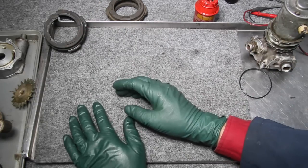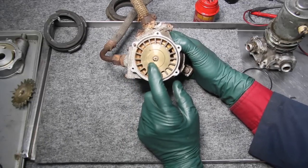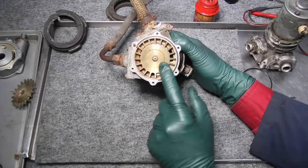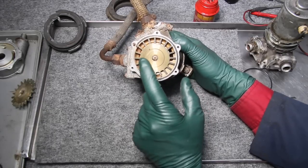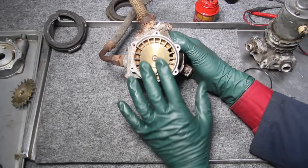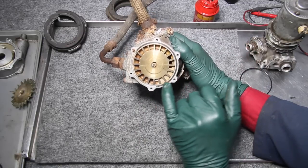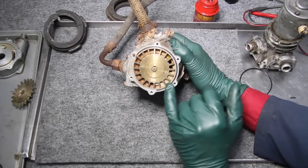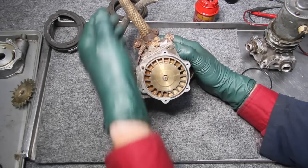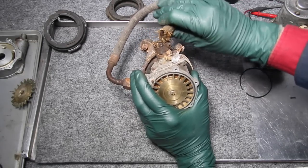In closing, there are a couple of things I want to say about these pumps from a preventative standpoint. Look at this one — look at how badly scratched that is. That's either from a lot of contamination in the fuel and the finger screen getting torn or just not getting installed properly. They do fall off, that fitting by the way. You want to make sure your fuel tank is clean and you don't want to run these dry. If you run out of fuel and just let the pump run and run, you will see this type of scoring. This O-ring here — look at how flat it is, totally flattened out over the years, so this one was probably leaking. And look at the hoses — anytime you work on these old pumps, plan to replace the fuel hose. Look at how stiff that hose is; if I twist it, it'll probably break off, and you don't want that happening when you're driving down the road.